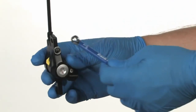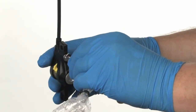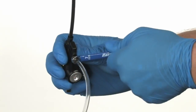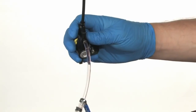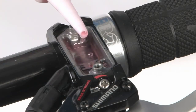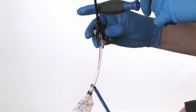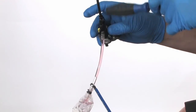Remove the bleed nipple cap and attach a 7 mm box end wrench to the bleed nipple. Attach the bleed hose with the collecting bag or bottle to the bleed nipple. Loosen the bleed nipple one-eighth of a turn and pull the brake lever a few times to prime the system. While periodically checking the reservoir and adding oil when needed, lightly tap the brake hose and all sides of the caliper with a small screwdriver to help dislodge any trapped air bubbles.